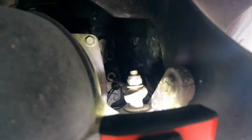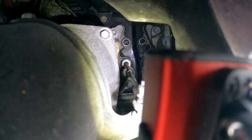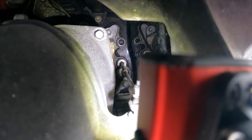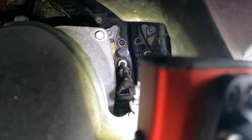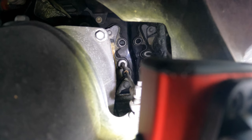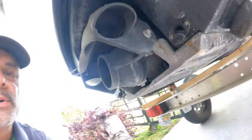To give you an idea, on the other side here's the steering mechanism for the turn. You can see it more easily over here — it's the same idea, and all the way in there's a white knot that goes through the hole, and in this case it's working perfectly. It's also plastic, and that's the reason they die after a while. If handled a bit hard, it'll break off and your steering or reverser won't work properly. That's why we're going to take it apart and put in a brass piece instead — that will take care of the problem.